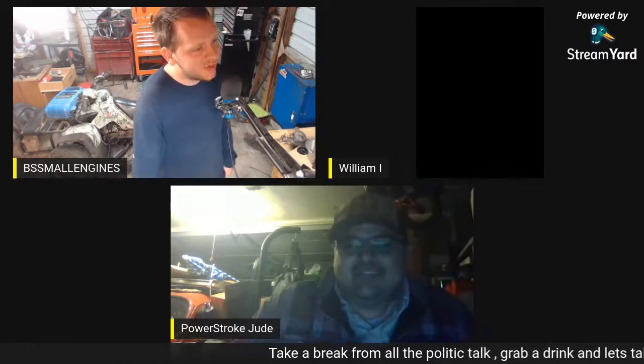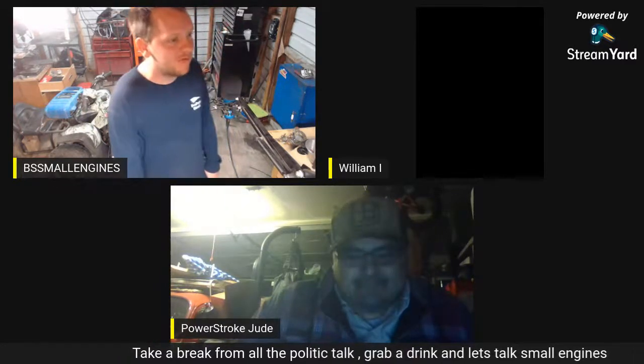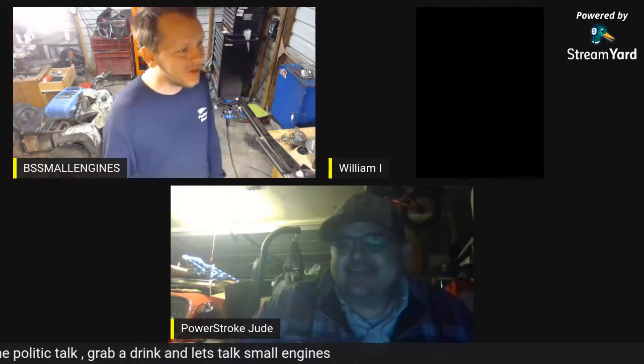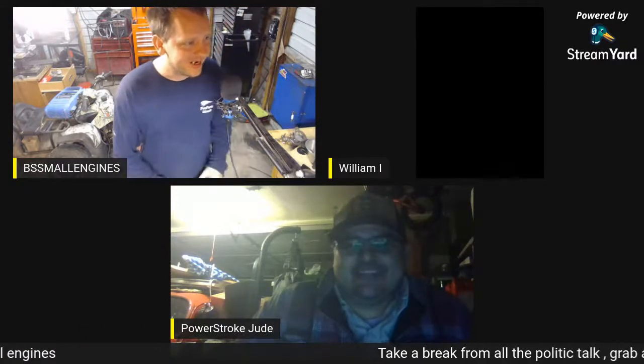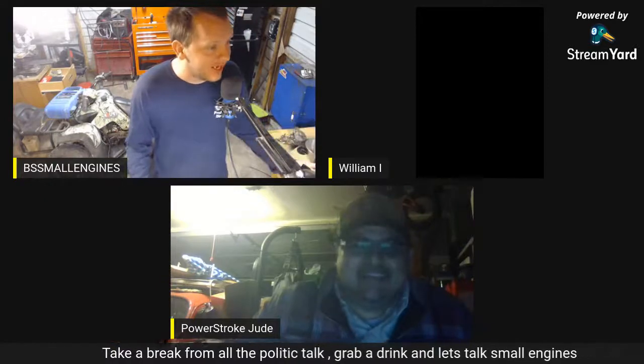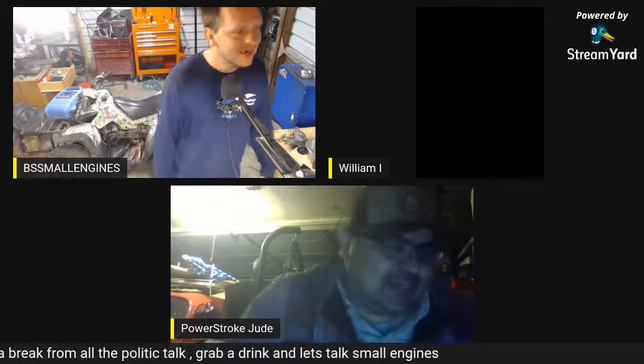My first 6.0 service, the on-frame fuel filter, I got a diesel bath in it. Oh man, you need to drain it. There's a little hex plug in there. You just got to drain it first. Otherwise, man, you learn that the hard way. If you take off that cap, you're going to get a bath.